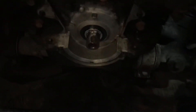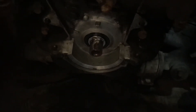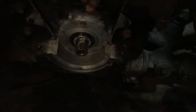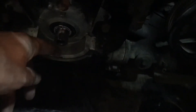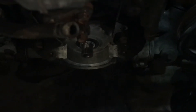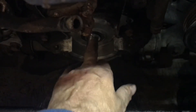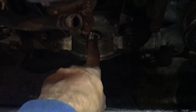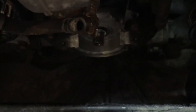I was going to replace the crank seal, but this engine was rebuilt not terribly long before we got the car, which is probably why the crank had this problem. This is a common problem among Miatas — the short nose crank, what these are called. They later remedied it by having a longer nose crank with a longer key and it didn't do it. What happens is when people rebuild it or redo the timing and take out the crank bolt, they don't torque it properly and it comes loose. So the only thing holding the crank pulley and timing belt pulley on there is the keyway — that's not designed to be that way and the keyway will wear away.